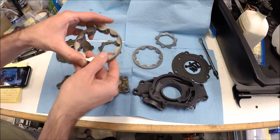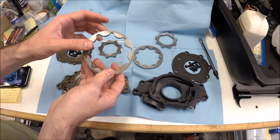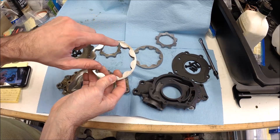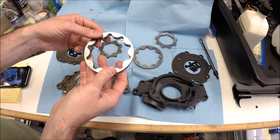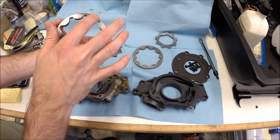The only reason I particularly pick up on that — when I had my Mustang, the two-valve Mustangs have an oil pump that's run off the front of the crank, it cracked the internal gear. It cranked it through there and took out one of the teeth on this as well. So I'm particularly observant of the differences in the thickness of this outer piece.